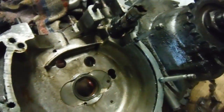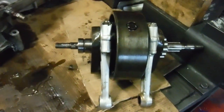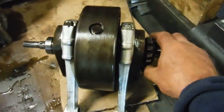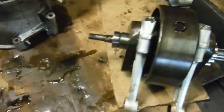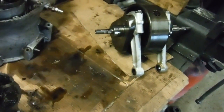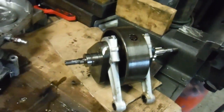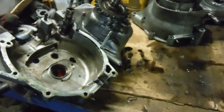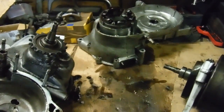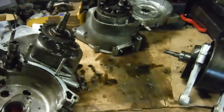I'll make sure I know what I've got and what I should have, and make sure everything is correct when it goes back together. Next I'm going to remove the conrods from the crank assembly, get the drive-side main bearing and race off the crank, get the sludge trap out, and have the crank stripped bare ready to go to an engineer for checking and measuring. Hopefully then we've reached the turning point and can start thinking about putting this thing back together properly.